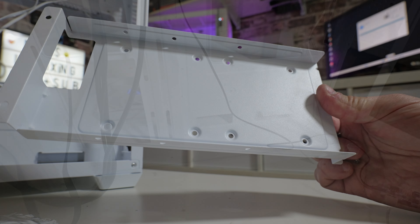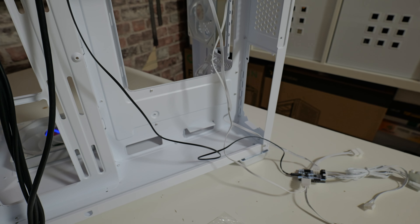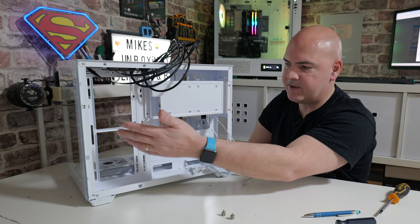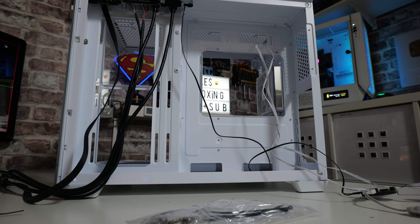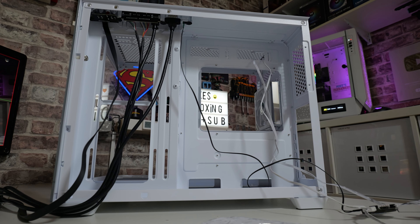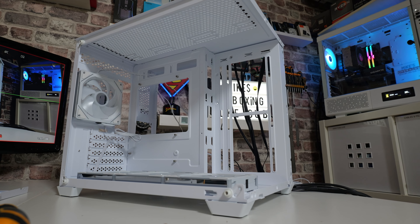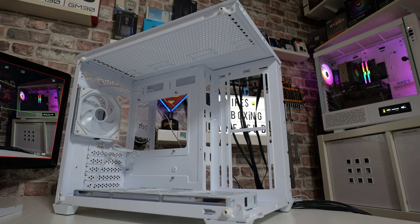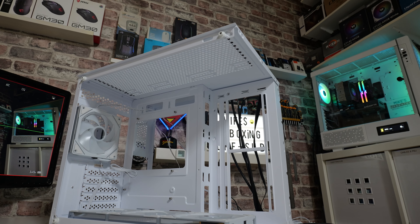At the bottom here, this is where your power supply is going to end up living, and potentially all of your leftover cables. If we move the cabling out of the way, you can see better what's going on. This is where the pass-through is for possibly a radiator or fans — again two 120s or two 140mm radiators. There's also a thumb screw there, and if you undo that thumb screw and four screws on the other side, this front section of glass can actually be removed. The glass itself is somewhat structural because it supports the top section, so with the glass out, there is a little bit of flex — do be careful and don't leave heavy things on there when the glass is not attached.